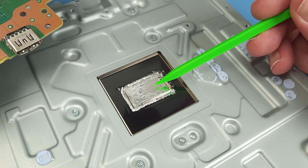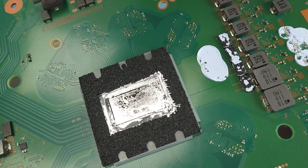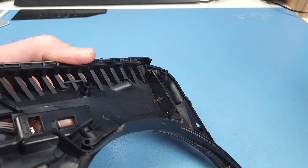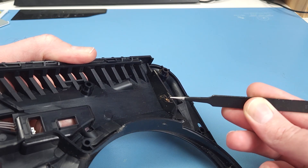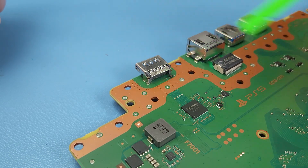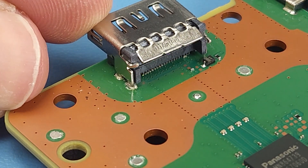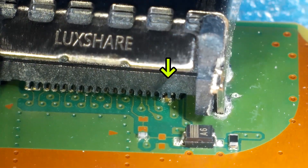There appears to be a dry spot on the APU — a common trend with PS5s that are used vertically. The heatsink is really clean, but what Aussie PlayStation would be complete without at least one spider? But 8 legs doesn't concern me — it's this 19-legged beast that does. The internals have burst through the back of the metal chassis. There's a tiny capacitor that's almost been gobbled up by the port. I'm hoping it's not damaged and that no pads are torn.